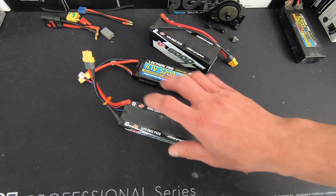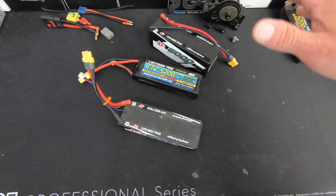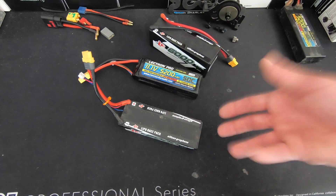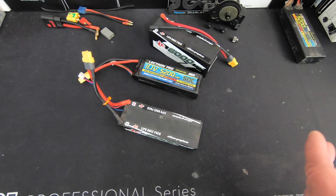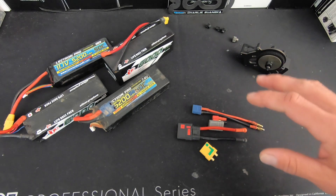The biggest thing with LiPos is having a designated charging area that's set up for this. Build yourself a brick area beside your garage, or dedicate a spot on the floor or top of your workbench, so you always have a designated area where you're keeping track of your LiPos — no stuff flopping around stored with them — and you can very easily check voltages. That's a quick recap of our five pro tips for nerd noobs.